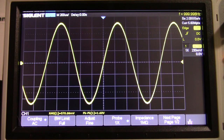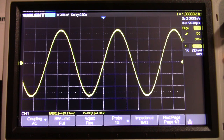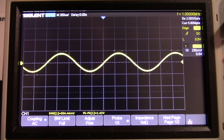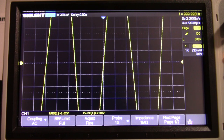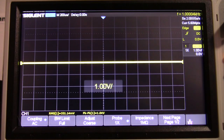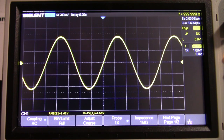Now we're on the M3 Pro, playing the same file. Volume level is at 41 and this one goes up to 60, so let's crank it up to 60. Look how much larger that is — 1.61 volts RMS. So 1.61 volts RMS squared divided by 33 ohms gives me 78.5 milliwatts. It's definitely living up to its specifications.